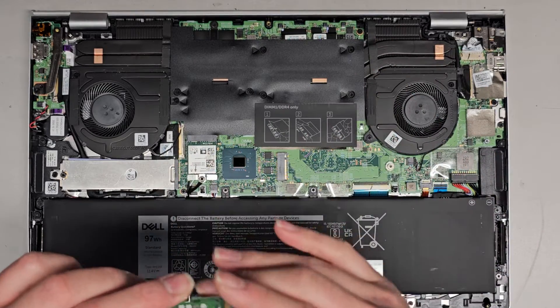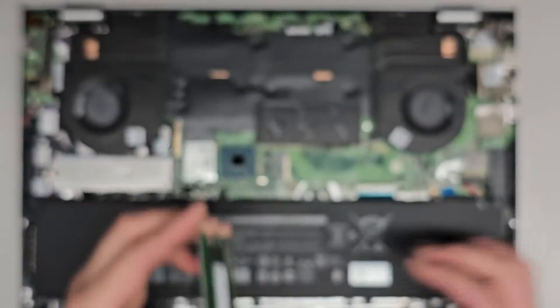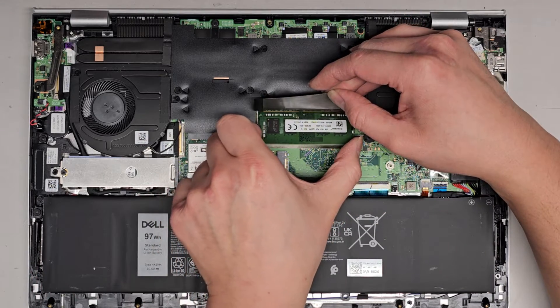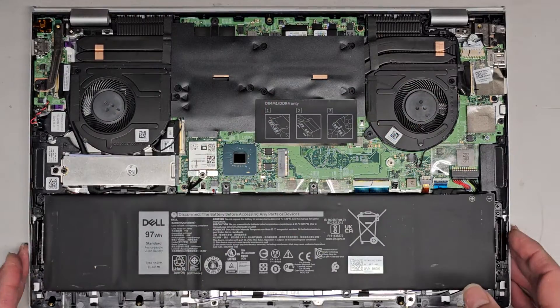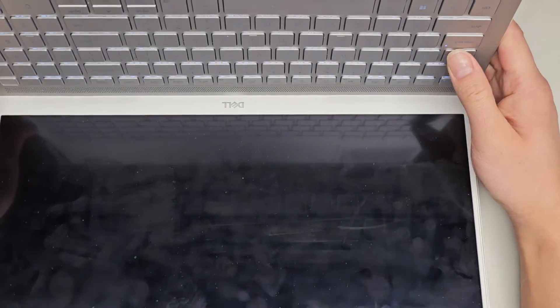It's super hot, this computer. The RAM is an 8GB PC4-3200AA. You should be fine with any PC4-3200AA RAM — if you want to put a 16GB stick, go for it and see, it should work. Sometimes if RAM is loose or having issues, pulling it out and putting it back in will get it working. We click that back in, open this back up, and let's see. It turned itself back on and the caps lock light is still solid, so that's sadly not going to work.